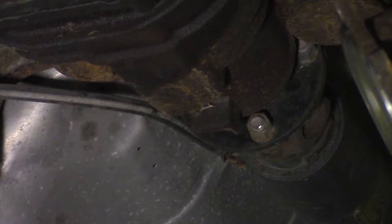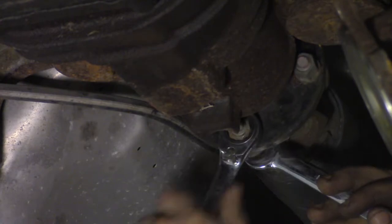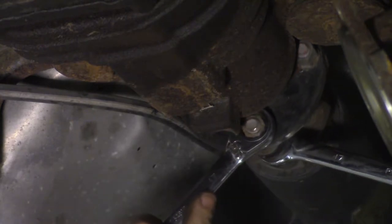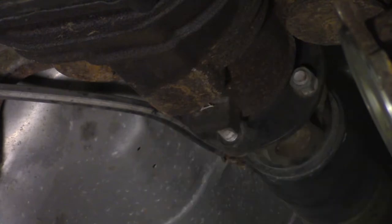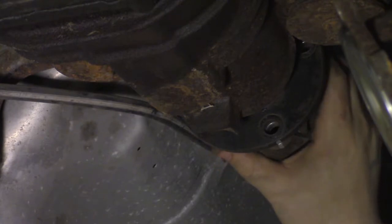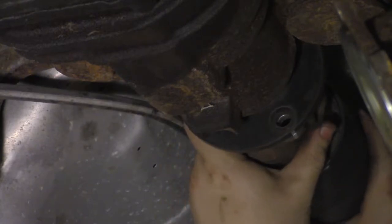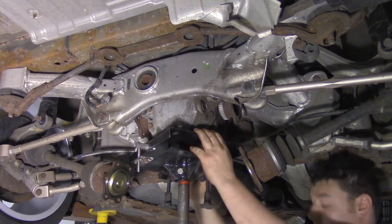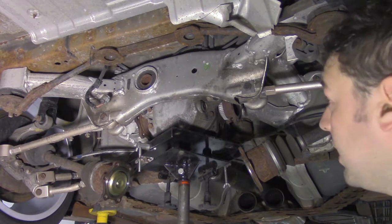So I'm also gonna flop it over the set frame. All right, the drive shaft is exactly like the axles. Take it, put some wrenches on there, and crack the old girl loose. I'm gonna push this thing forward, and it will usually move pretty easily. And then just drop it down, just cleaning on the exhaust. There we go. And down.